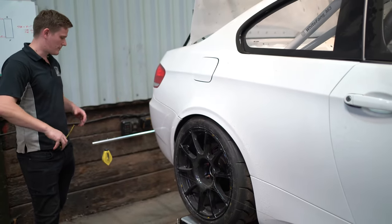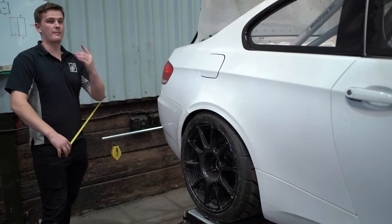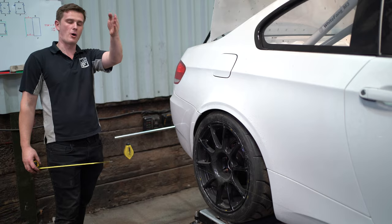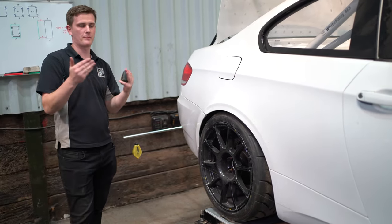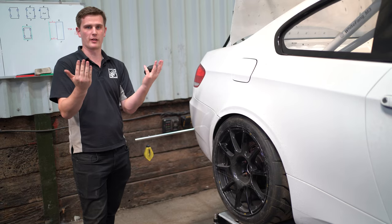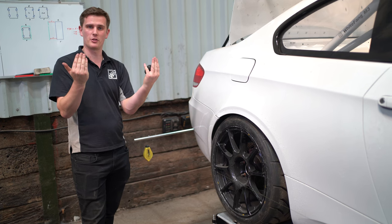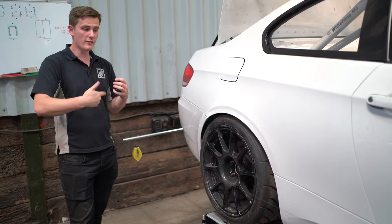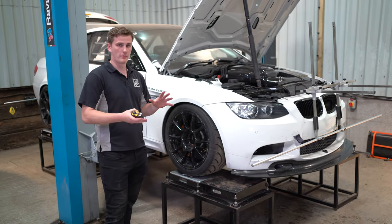It's often a two-person job, but you measure from the rear pole to the front pole to make sure the left-to-right measurements are exactly the same. Set the rear bar square with the rear axle, then set the front pole square with the rear wheels. We do this because if caster is adjustable it can affect where the wheel sits inside the wheel arch, so we can't always trust that the front edge of the rim is in exactly the same place chassis-side. If your caster is perfectly symmetrical, you could measure from the rim to the pole at the front as well.